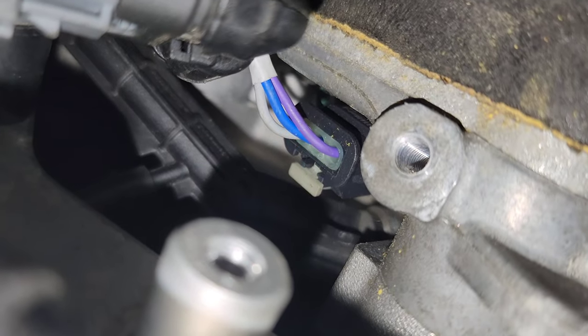We still need those wires that we removed so the car can still communicate. There's a connector that came with the kit — remove the white locking piece in the middle with a pick tool, then plug all four of the wires we removed into this connector. That allows us to plug it back into the body domain controller so the car can still see those signals even though we're tapping into them for the motive reflex. This lets the car run just like normal whether the motive reflex is on or off. Then put the white locking piece back — it only goes in one way, so if it's not going in smoothly, turn it around. Then plug that connector into the body domain controller as well; these two pieces just slide into each other and snap into place.